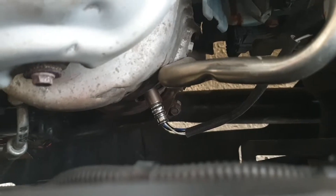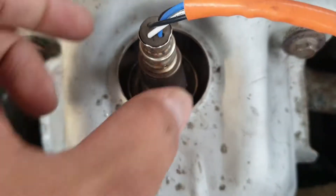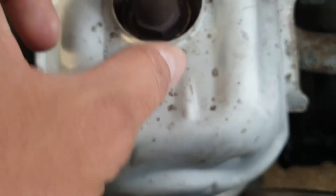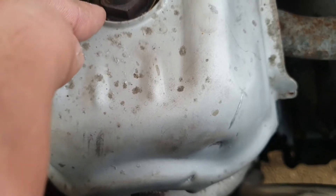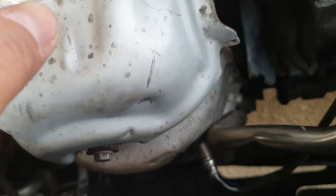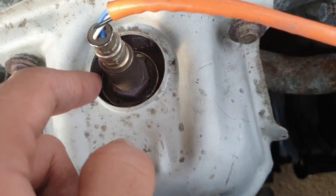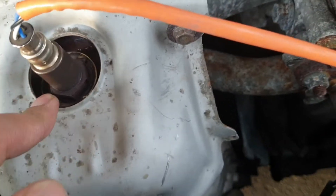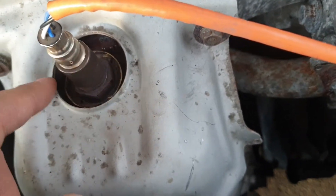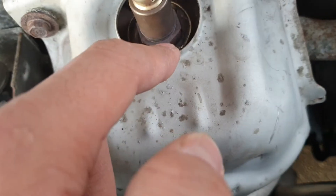The other sensor for the Honda Civic 2008 was slightly longer, so I had to cut the side metal piece to fit it in and cover the hole. I cut it with a cutter so I could put the sensor in to cover the hole temporarily. I think maybe because of that cut metal piece, the last emission code is still there. So I'm not sure — I need to buy a new correct sensor for this one. I'll see how things go after disconnecting the battery.